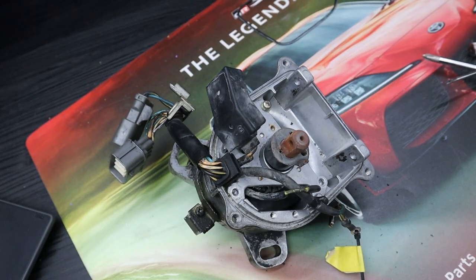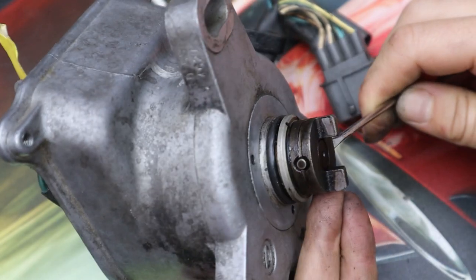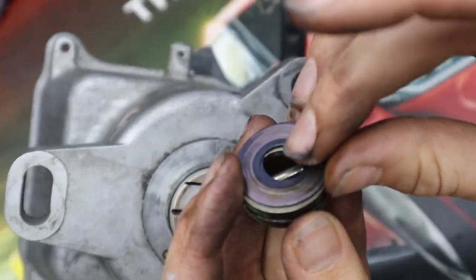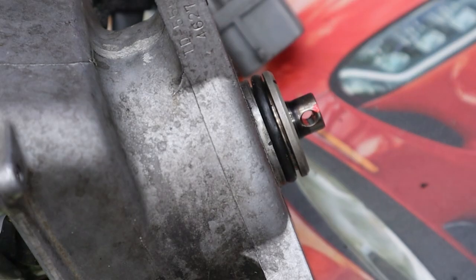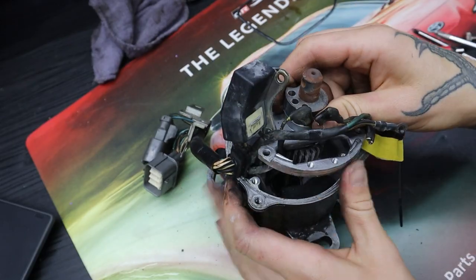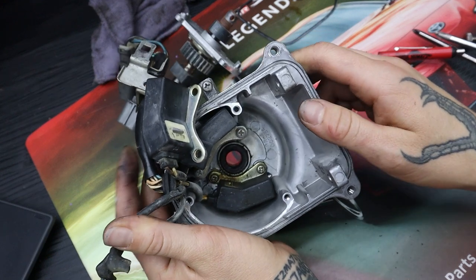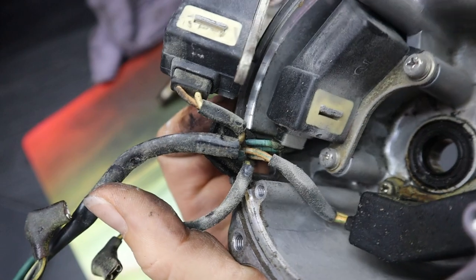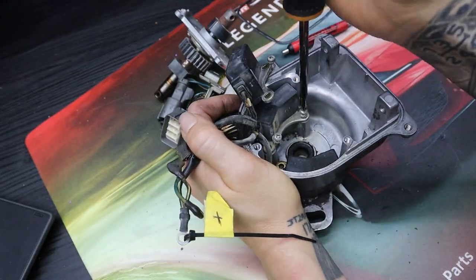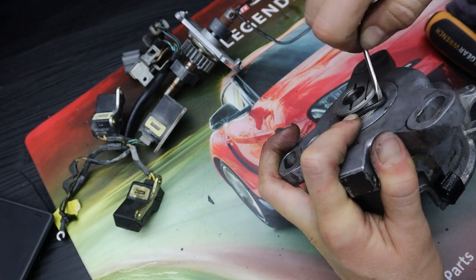Now removing these last three screws that hold the center portion in place. On the flip side I'm gonna have to remove this C-clip — it's a little bit tricky so be patient. Then I'm gonna remove this little dowel pin and slide off this keyway with its washers. You may have several shims or washers here so don't lose them. I'm marking the side of the shaft that the keyway with the slit in it was on. Flipping the distributor back over I'm now able to pull out the guts. Looking in the distributor housing we can see our two other magnets and that dreaded seal that always starts to leak over time — that's what causes people to have to replace these. Also look at the wear on the tips of all three magnets. I'm going to remove these so I can clean the distributor housing body thoroughly. Now I'll pop out that seal in the bottom using a flathead screwdriver, then flip the distributor over one last time to remove the o-ring on the backside.